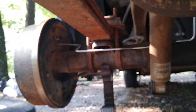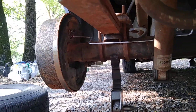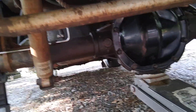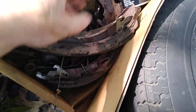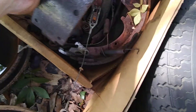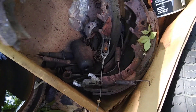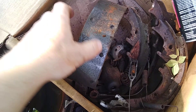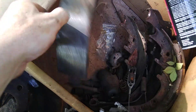The lines look good and fit well. I've already replaced the shoes, drums, spring kits — the whole rear end has been rebuilt with new axles, new seals, and new Yukon gears. These are the old shoes that came off the truck — they've been sitting outside so everything's rusting up. These shoes were actually replaced back in 2002, the year before we took the truck to California.